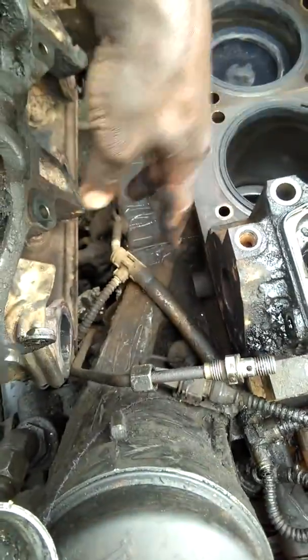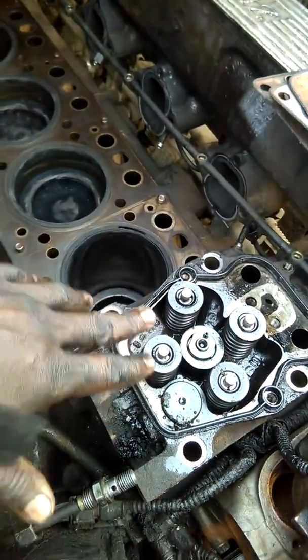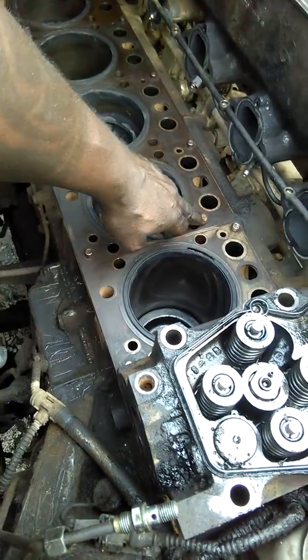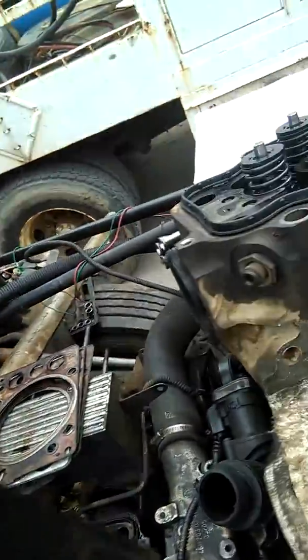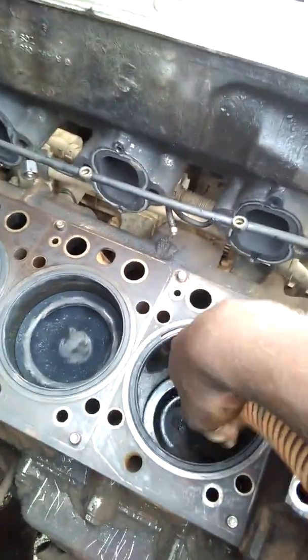After this you pretty much button everything up. There's a connection here for fuel, and once I get this back in place there are oil connections all along here. The basic thing I want to point out is: when you pull the old stuff out, take the time to clean this surface. Get a blade and scrape off all the debris left over from the old gasket, scrape it off as best you can, wipe it down, and I would even say get a vacuum to make sure there's no debris along the edges. Then you're ready to put your new head gasket in place.